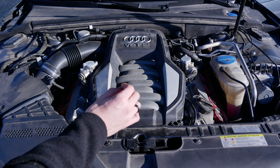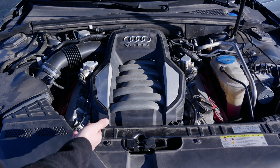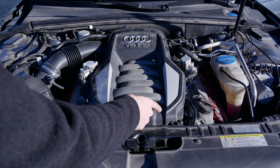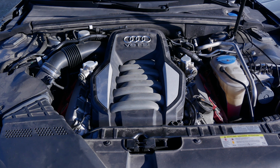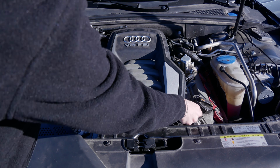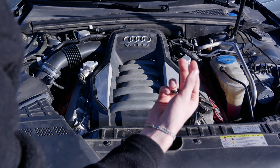Now, fortunately, I haven't had to do any serious maintenance on the engine. The only thing I've really had to do in here, apart from what I need to do, which is clean the thing, is include a T-splitter for a vacuum hose, which is supposed to go back to the mufflers, and that in the Armytrix system controls the valve, so you can open and close the muffler valves in there for a loud or a quiet sound. And that's actually right here. I'm surprised this hasn't melted yet because it's sitting right on top of the block.